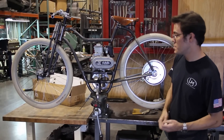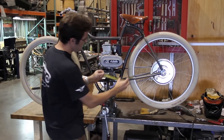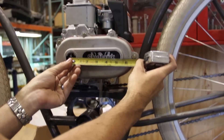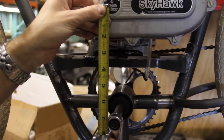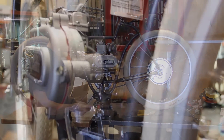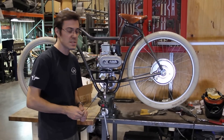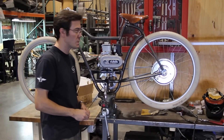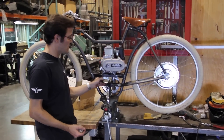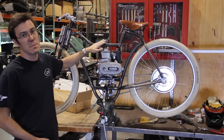There are a couple of other issues with the engine mounting. The transmission cover is about the center of the crankshaft, and the length of the case from there is right about seven inches. If we were to rotate it down, seven inches would have the transmission cover interfering with the shaft for the cranks, and the sprocket on the back would interfere with the engine mount — we'd have to modify the engine mount to allow the chain to come out, which would mean raising the engine even further. We already had to raise the engine mount five-eighths of an inch over the original design just to clear the sprocket for the cranks. If we go any higher, it's going to mean significant redesigns to the frame.